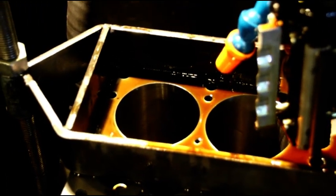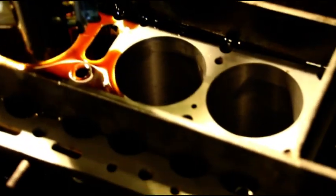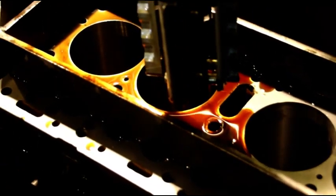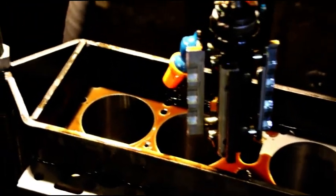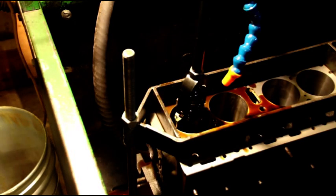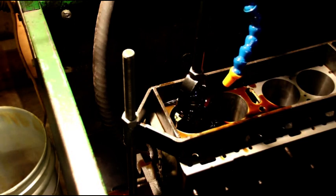We've got some finished engines to get running. The weather has been terrible and I've kind of had to have half of it sticking out of the shop, so we're not going to do it on a rainy day. Engine run videos will be coming soon and we'll just keep moving on. Let's show you a little bit of Lou's honing. We're just going to creep up on each cylinder and hand fit the pistons like everybody's seen me do before. Get the lube started and continue on with the honing.